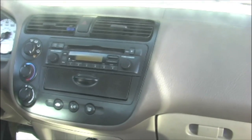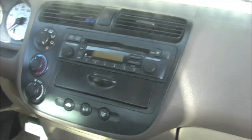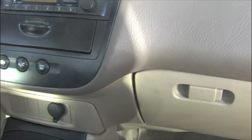The first thing, like I said, is to disconnect the negative battery terminal. The second thing is you need to pry out the accessory or pocket trim panel. I think we need to release 5 metal and 1 plastic retaining clips inside, which could be done using the panel tool or the pry tool, like this one here.